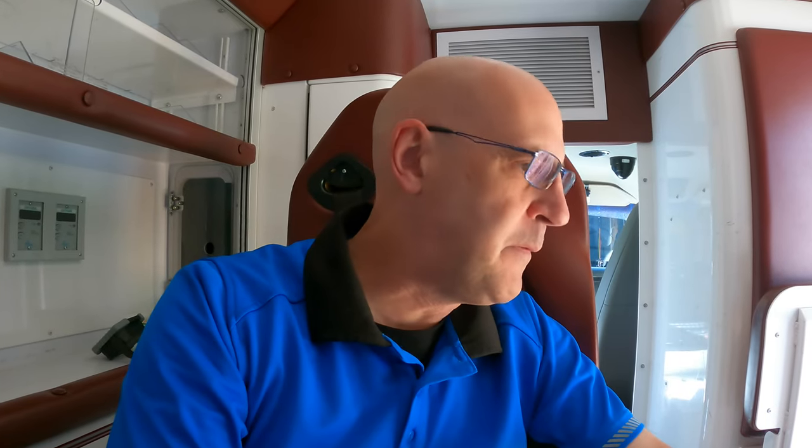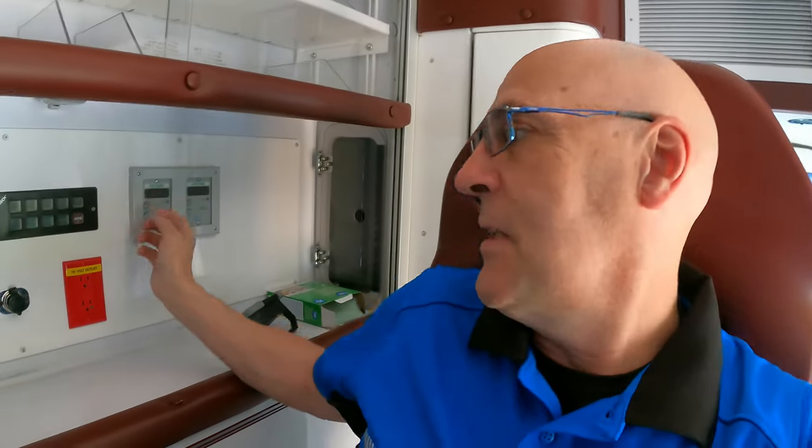One thing I have a concern about is when I was up near Winnipeg with Ken, the fellow who had this ambulance for sale, the oxygen tanks in the side, of course, they're not there. But the electronic valve sensors that would go on top of the tanks obviously are detecting no pressure or low pressure, and they were sending an error code through to the driver's console, as well as the alarms to these consoles. Specifically, the driver's console was beeping a lot. Like every 8 or 10 seconds, it would give a series of very loud screech beeps, something like the olden days Timex watches, the electronic ones that first came out. Anyhow, super annoying.